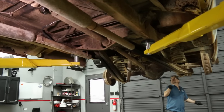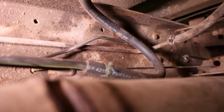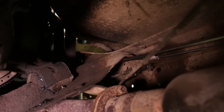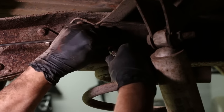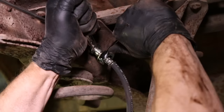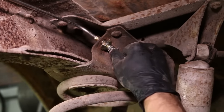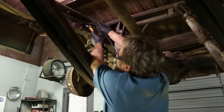I've blown out my line, but I've got the rubber cap back on it, protecting it just in case as I'm feeding it in the frame rail I jam some crud up into it. My hard line is coming through there and I connect now to my flex line. With that snug, I've got a clip that'll slide back there and lock that circuit right into place. This is our retaining clip — it just gets tapped in. Now we're just going to loosely bolt in our brake line retainer, and we're able to reuse one of the original ones.